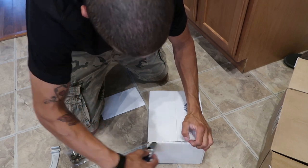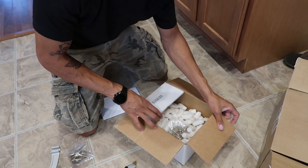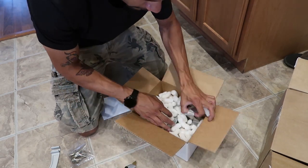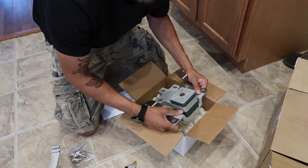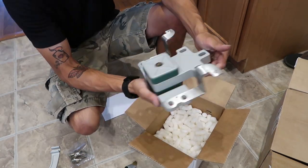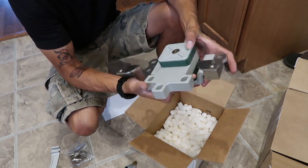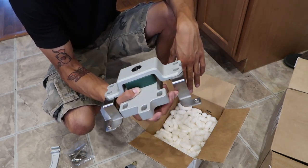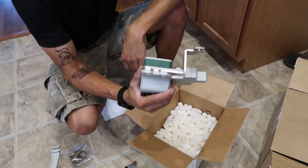This one right here will be the biggest upgrade. Originally when they did trans mounts they just took apart the OEM one and put their own rubber in, replacing the OEM rubber but keeping the OEM design. Well now they have this nice billet design that should be a lot more sturdy for the trans. Having a manual trans, you definitely want that to be sturdy.